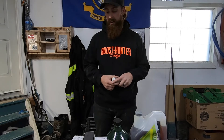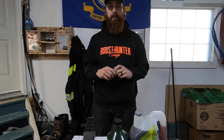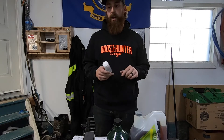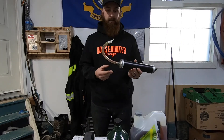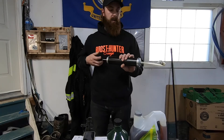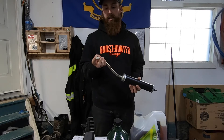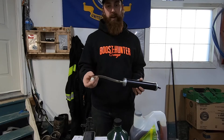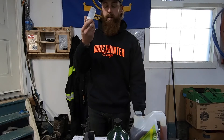Originally I was thinking I'd just stick the container under as I was draining the oil at the bottom of the pan, but I looked at their website and they don't want you to do that - they suggest drawing it from the top through the dipstick tube. So I borrowed a hand pump from my dad and we're gonna see if I can use it. The hose is probably about the same size as the dipstick, so I'll just tape it up and try to get enough suction.